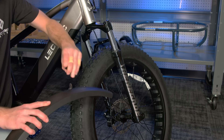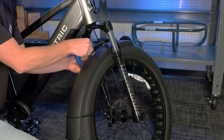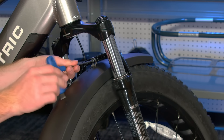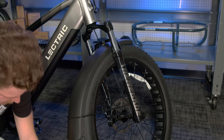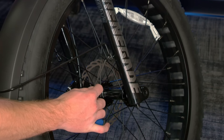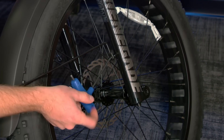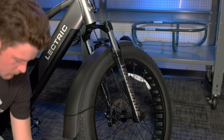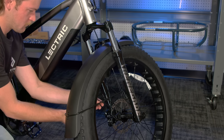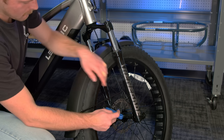Now, remove the shipping cover off the fender hanger, and line the hanger up with the bolt hole on the fork brace. Then, using a 4mm Allen wrench, screw on the 4mm bolt. Now, line up the hole on one side of the fender stay with the bolt hole on the fork. Note: the longer portion of the fender should be at the rear of the wheel. Using a 4mm Allen wrench, screw the 4mm bolt through the fender stay and into the fork. Repeat this process on the other side of the fork. Once the bolts are fully screwed in, go ahead and tighten each one fully down to make sure there will be no movement or rattling while riding.